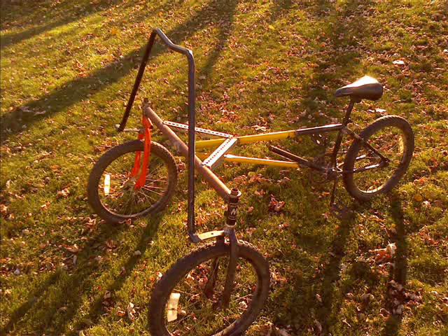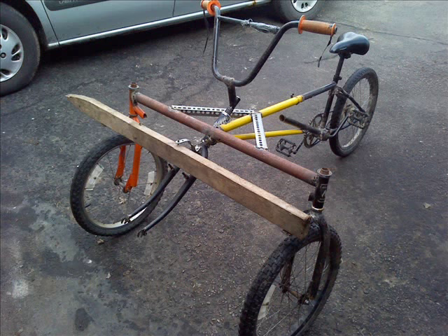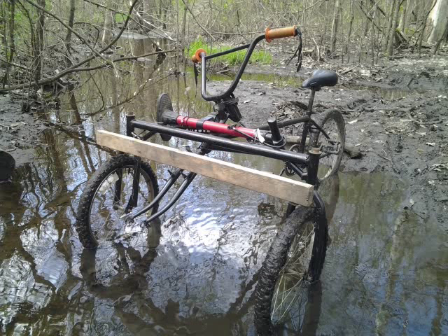However, this failed to work because the lawnmower handlebars continually were in the way and it was too hard to turn them. So I then proceeded to cut off part of a third bicycle and its handlebar assembly, and directly weld it to my preliminary frame right at the T-bone section, or the cross section between the front tires, allowing it to turn by using a 2x4 connected with a couple of bolts to the main front tires. This created a fantastic makeshift tie rod that held all three together, allowing them to turn simultaneously so I could actually steer my bicycle.